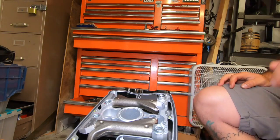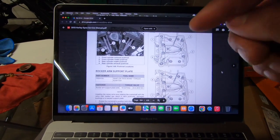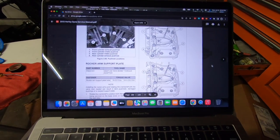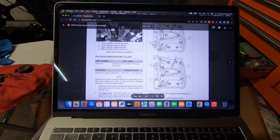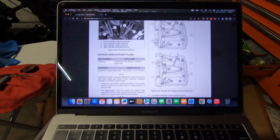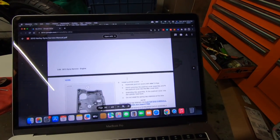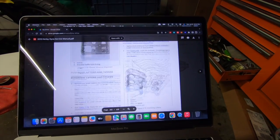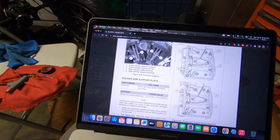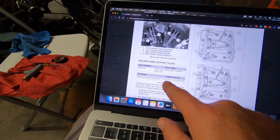Now we gotta torque it up. Down in the description, you can download the manual, and right here on page 284, it talks about the torque spec for your rocker arm support bolt. Obviously, these are the Harley-Davidson ones. They're just bolts, where the S&S is a little bit different. But as far as the size and the torque, it should be around the same, 18 to 22 foot-pounds.